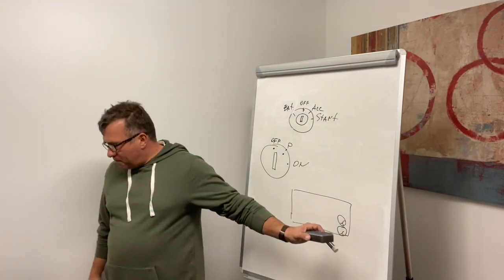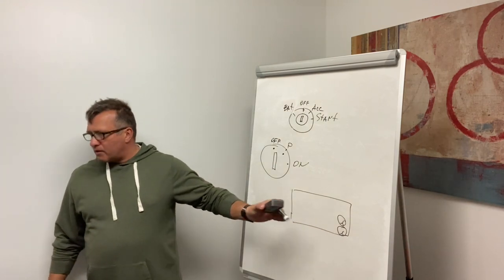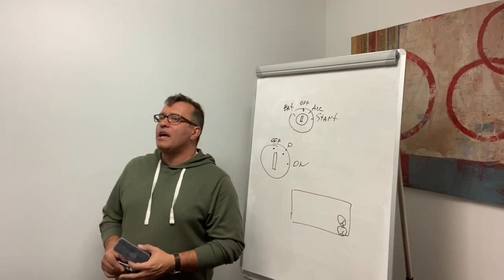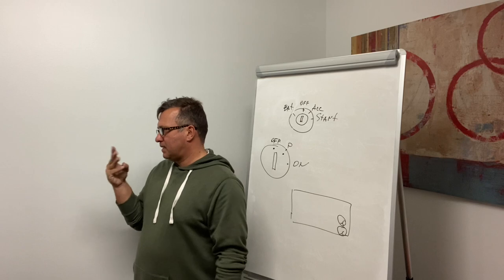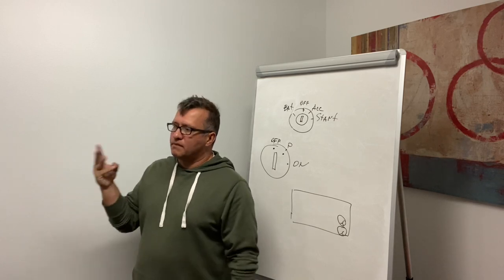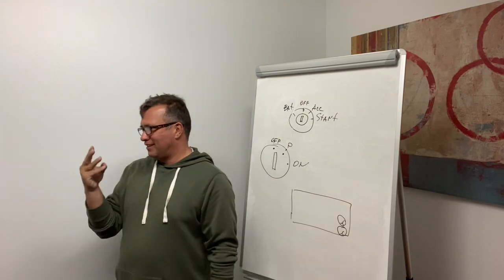So we're building up pressure. We're checking our air gauge by building up pressure until the governor cuts off between 120 and 140. We're going to do it three times during the test. Three times, please, very important. It can cost you the test. It can cost you failure.